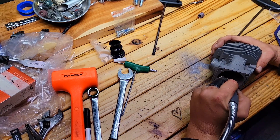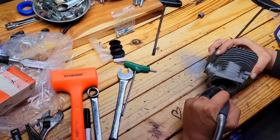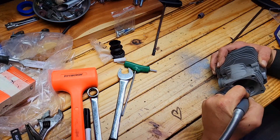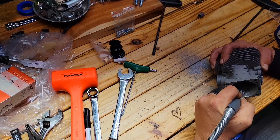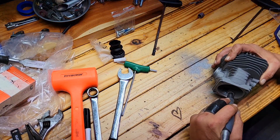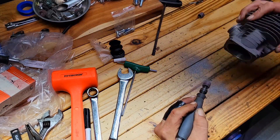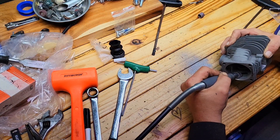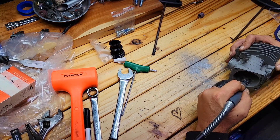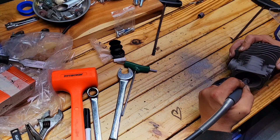If you can avoid that, great. Don't get me wrong — there are a lot of OEM saws and aftermarket saws where if you're not able to prep your cylinder, no worries: just pre-oil it before you install it. That piston will do all the honing for you, so to speak. But it's good to go in and prep your cylinder. It's a good-looking cylinder. You can get these from Amazon — I'll throw a link in the description. They're very affordable, sometimes as cheap as $35. It comes with the cylinder, piston, wrist pin, bearing, and circlips.